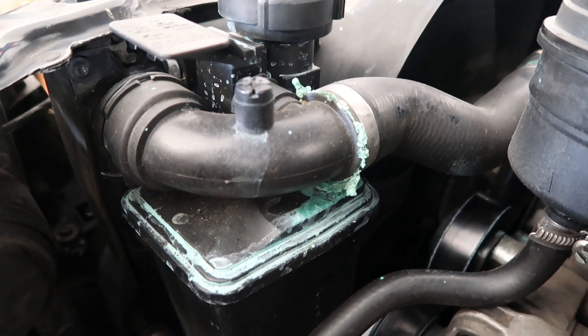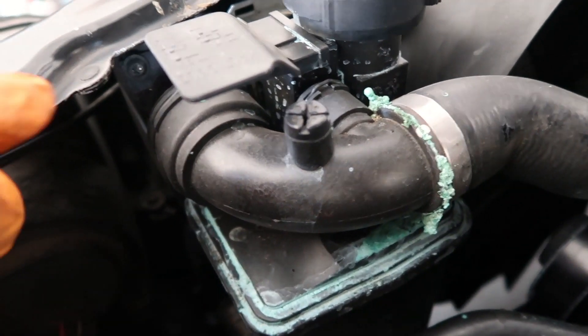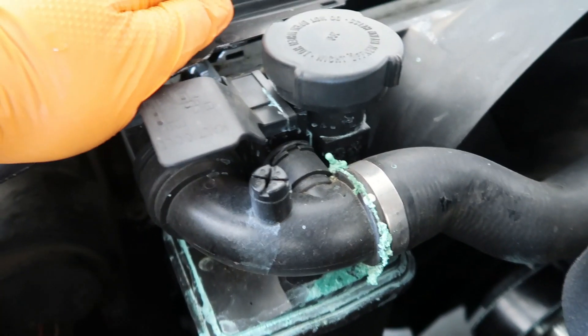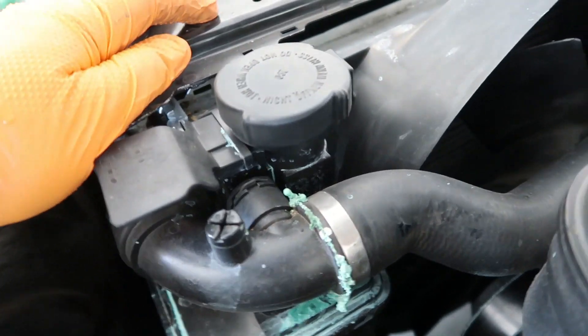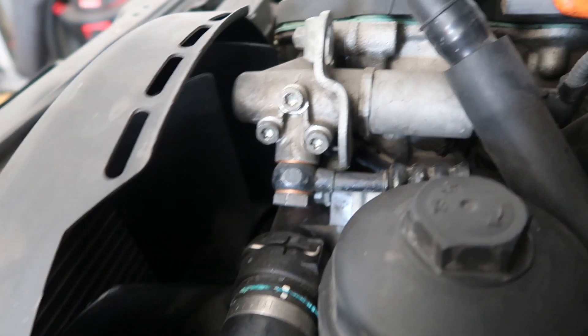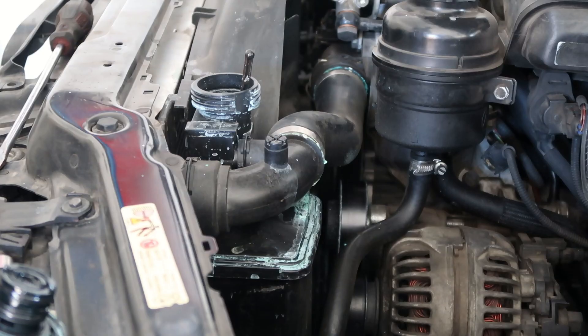We got that out. As you can see here, you can see all this blue stuff around it — that's because the line is leaking, it's obvious. What I'm going to do is remove this piece right here. If there's a lot of coolant in the system still I may have to drain a little bit, but if not it'll just be this clip here, that clip there, and then that clip over there. You can see blue coming from around all of them.